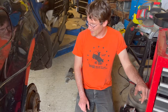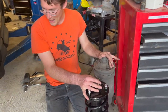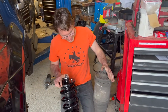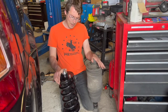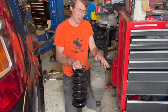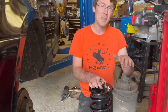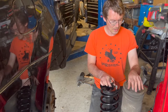We got this rig. The previous owner had already started dissecting the air suspension — it's kind of unfortunate. I would have actually preferred to fix it, but he'd already ripped out the pump, cut all the hoses, cut some wiring, and I've decided that odds are they're just not gonna be fixed. The rears actually looked okay and seem to hold air. The fronts are leaking and shot. There are a couple of downsides moving to coils: number one, you lose ride quality; you also lose some height. Compared to the air strut at maximum suspension, you lose about an inch of potential lift, which is unfortunate. Eventually I'll probably make it up with strut blocks or some other way of lifting it. Nobody really makes a lift kit for this car, so it's going to be a little bit of cobbling and fabrication — that's a later-me problem.